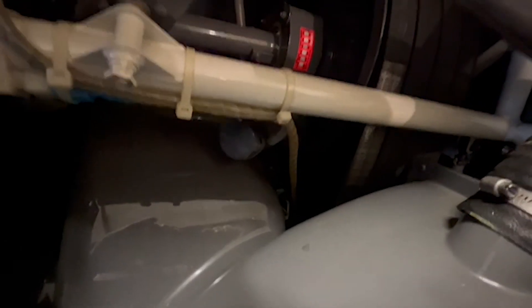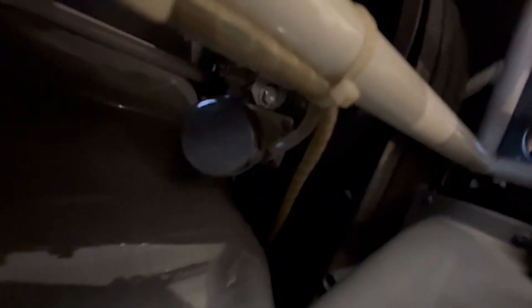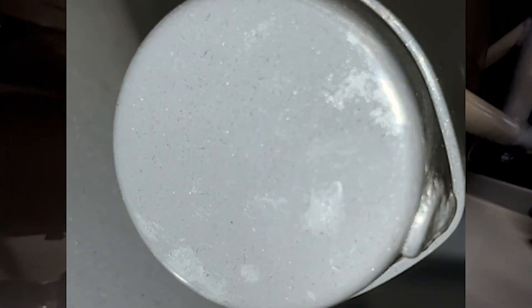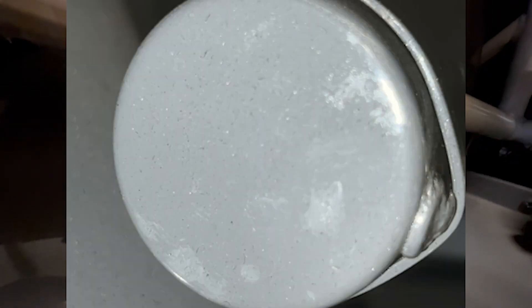Let me show you a nice little trick. You've got a tool in your pocket you probably never realized you had if you're a mechanic or doing a good preflight. If you're trying to look at something hard to see - like this motor that drives the belt tight - you can't hardly see it at all and even a phone light isn't worth much. But simply take a picture of it: use your iPhone, put it in there, turn the flash on, and take a picture, and you'll get a good visualization of whatever part you're trying to look at. Newer iPhones in macro mode can literally take a picture of something just a few millimeters away.